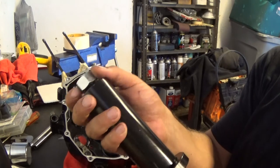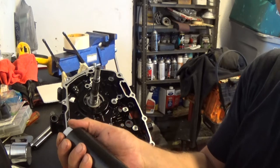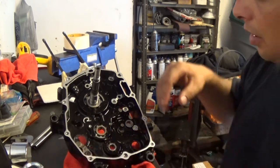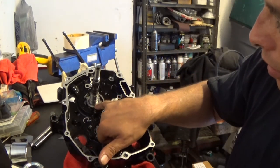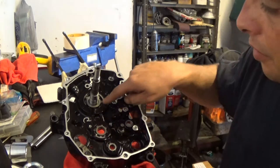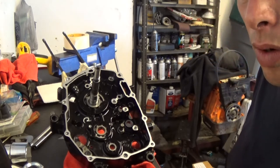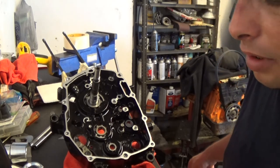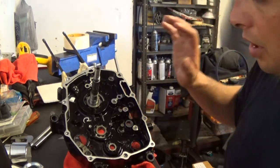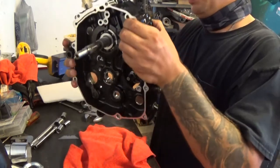And in turn, I just kept on cranking this down, pulling the crank through the bearing that is lubricated on the crank itself and the inside of the bearing, so it makes it a little easier, until there's a little hole here. I believe it was like an eighth inch to center from the top of the bearing to the center of the hole, and I measured the same distance on the crank that came out of the original crank. And that just basically popped right out with a little slight tap of a hammer. So it seems like it's all bottomed out. It's perfectly where it needs to be. So now, turn this over.